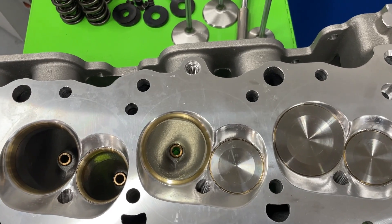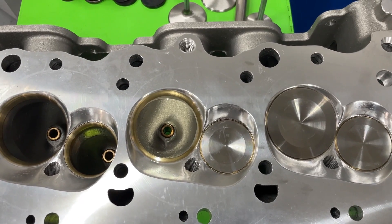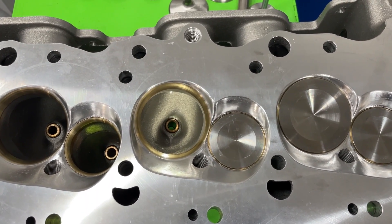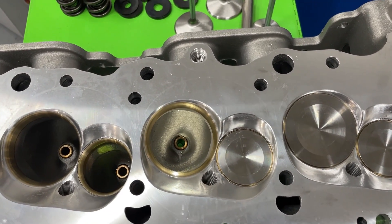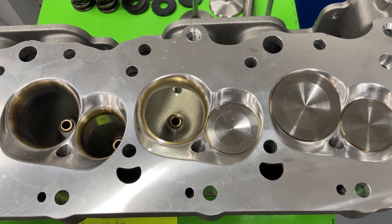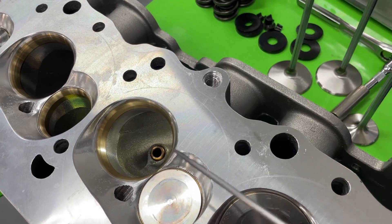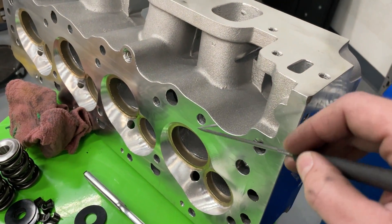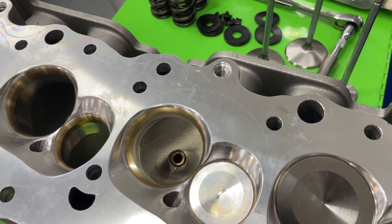This head may look gigantic, but when I measured it, the minimum pinch was 4.4 inches — really not that big. I believe what happened is they took the 1201, which is the smaller CNC-ported head, and made it an as-cast head selling it as the 1203. It's comparable to a Headhunter in size. Don't judge it by CCs, because the reason the CC number is so large is that the runner itself is very long. Cross-section is 4.4 — about the same as a Headhunter.